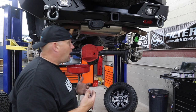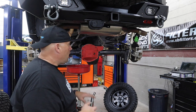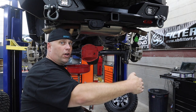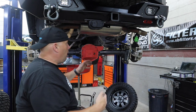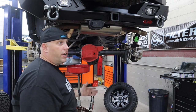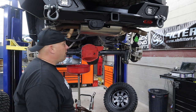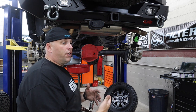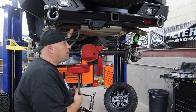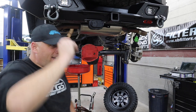Something to consider if you're going to big tires — you might want to plan this type of gear swap job in the near future. I'm taking it out to the most extreme power level at 5.13s because we're only on 37s now. I could get away with putting 38s and 40s on here at 5.13s, but a good ratio would be 4.56 or 4.88 for 35s. If you want to go 35s and eventually go to 37s, 4.88s is probably a good gear ratio. I jumped straight to the big boy tires — I made that leap.